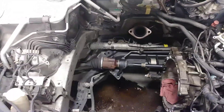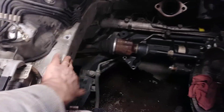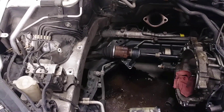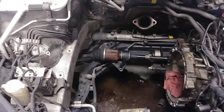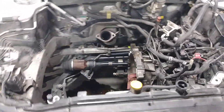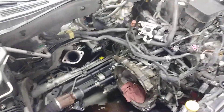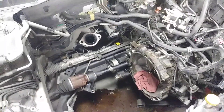One thing I found pulling this out the top with an automatic transmission is the crankshaft bolt and pulley were hitting the frame rail. I ended up pulling the pulley off — wasn't really happy to have to do that, but it came out easy enough. The other problem was the torque converters on the Mazdas have a long nub on the end that gets rusted into the back of the crankshaft. It kept going in and out — finally got it separated.